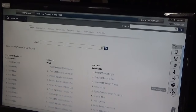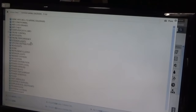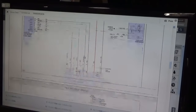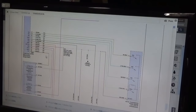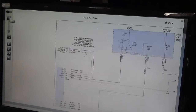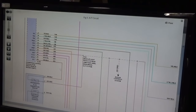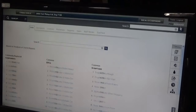Let's take a look — obviously we know the engine controller is the PCM. The transmission I don't believe has a separate TCM. And there we go: automatic transmission — right there is our proof. That also is the PCM. So that confirms all of that. Engine, transmission, and PATs are all going through one module — the PCM — and none of them are communicating.